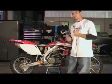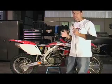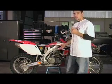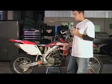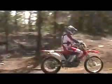So more air in, more air out, and no emission restrictions meant we had to clean up the jetting — it was not all in spec anymore. I talked to the guys from Precision Concepts because they're used to unplugging these things. They sent us some jetting specs, I got it dialed in a little bit, and it made it run a lot better.